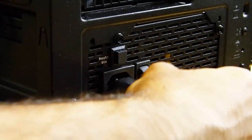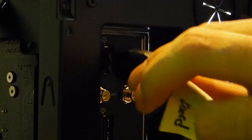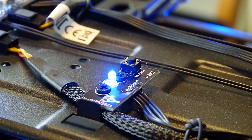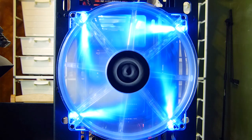When powering up the PC for the first time, it's best to only connect the bare minimum of components, so if a problem occurs, you don't have to rule out unimportant stuff. Just motherboard, PSU, CPU, RAM, and GPU are needed. For the sake of the video, I edited everything in chronological order, but I only had the bare minimum connected during the actual first boot.